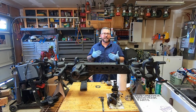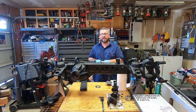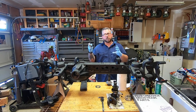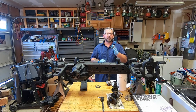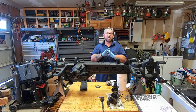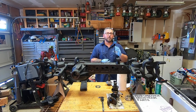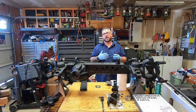A couple of things I did in preparation: I went ahead and took the old inner race and turned it into a setup race — it should just be able to slide in and slide out. All I did was find a way to chuck it up in a drill, spin it, and polish the outside with sandpaper. I'm going to be shimming behind the race. I've seen a lot of videos and that's what everybody else is doing, and that's what some of the instructions tell me, so I'm going to go with that.